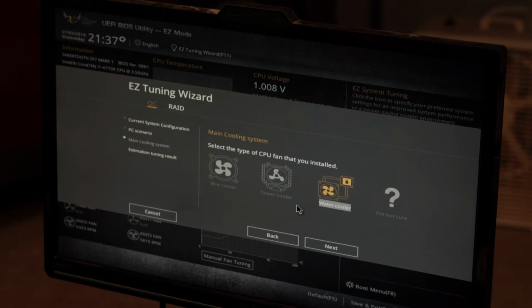The other thing you have to remember, the way I've always been told, and I'm not sure if this is 100% accurate: when they make the chips, they're on a wafer, and then they test them, and they take the best of the best and make those their highest end ones. The ones that aren't so great, they might put on a chip and mark them down so they can't go as fast, because they won't be as stable. So it's kind of a gamble when you get a chip. Some of them overclock awesome, some of them don't, and it works the other way too. Sometimes you can overclock an i5 up to what the i7 should have been, or the lower i7.